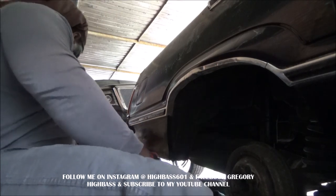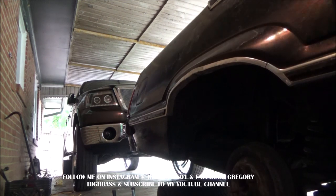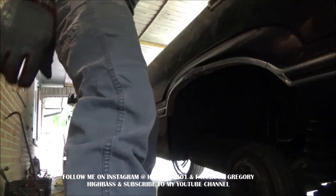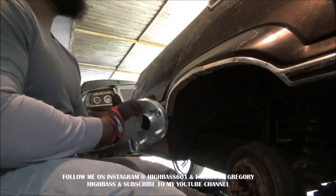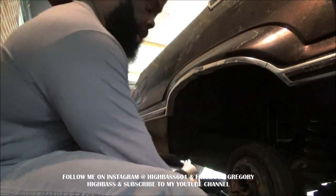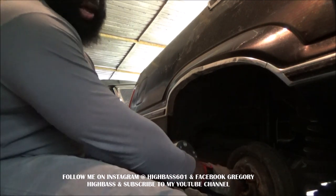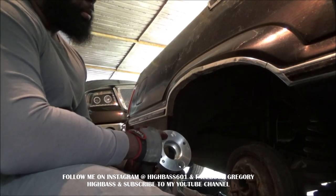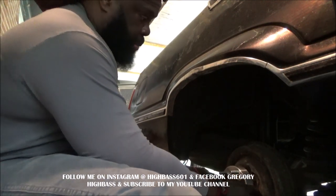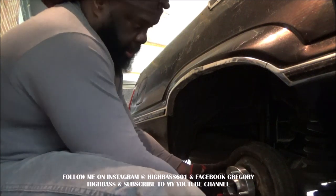So the first thing I gotta do is this spacer. The hole is too small to go on my half inch. Like I said, the guy that built these spacers built the spacer hole for a 3/8 stud, but I got a half inch stud. So when I go to put them on, see, it won't completely go on.